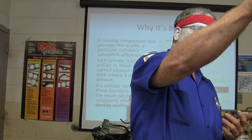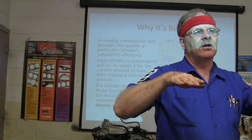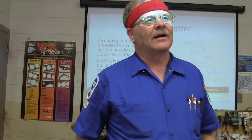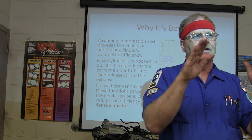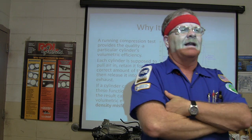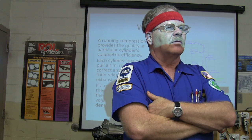However, if you take that manifold that came off that Mustang right up there and look in there, it's got some little runners that almost close off the air going in. They open up when you want more power, but at idle it almost closes them off. I've held that up in front of people before, and you can operate it and see the little flappers going. Why would you want to almost close it off? What would be the purpose of that?